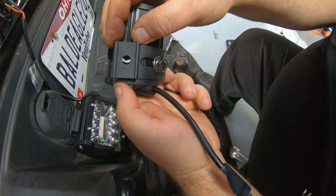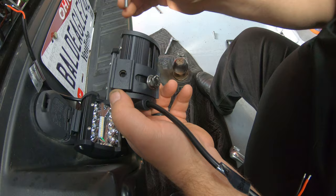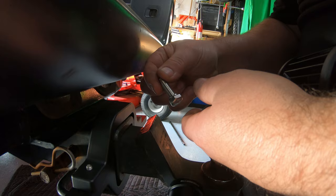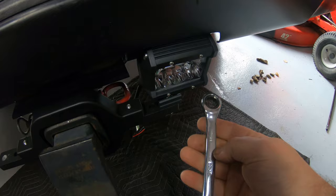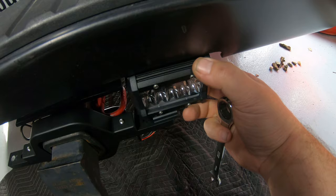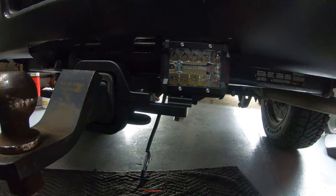You can take an Allen wrench to line up the captured nut, then put your mounting bolt through it. Take the lock washer, put it on the bolt first, then the regular washer, put your light where you want it, and come up through the hitch to start the bolt into the light. Tighten these down — they're 14-millimeter. You can aim the light a little bit toward the center or toward the outside, and you can also slide it in and out. I want mine out as far as possible. When tightened down, it's tucked up nice and secure right underneath the bumper, giving protection for the lights and good visibility.